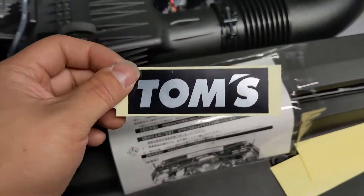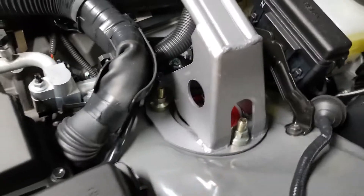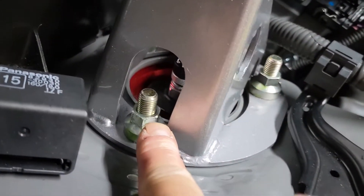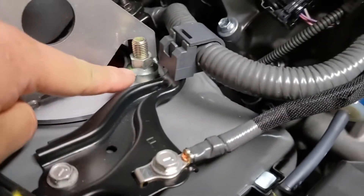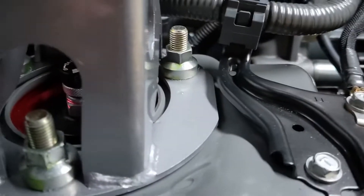Put it on my sticker stash I guess. Alright, all the bolts are torqued down — they were 67Nm. Here are some tips: this bolt's kinda hard to get to, you gotta finger it, tighten it a little bit. And then this one also, you have to put this one in first because of the clearance issue.